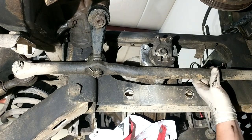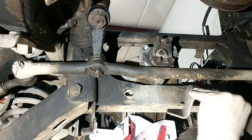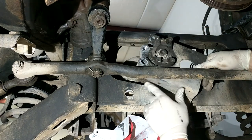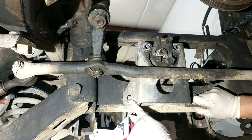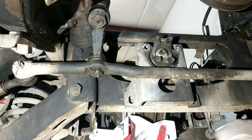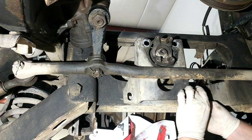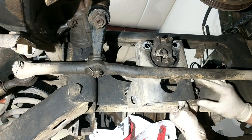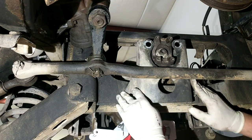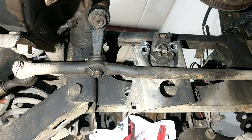I've got the two top bolts on the bracket. Now if you kind of wiggle it and flip it over — see how the elongated hole works. You just want to get these somewhat tight, but not fully tight — just so you can still move the differential back and forth to get these other two bolts into the hanger bracket.